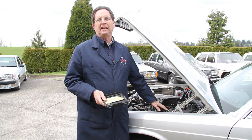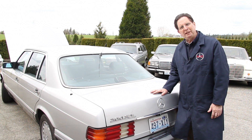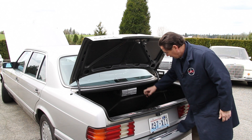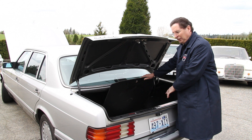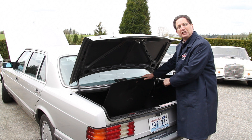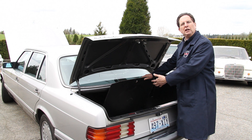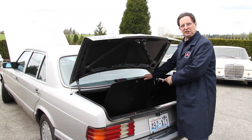Once you've determined the fuse is okay, we need to move on to the auxiliary pump. The 126 vacuum door lock pump is located in the trunk right next to the spare tire. If you lift the cover, you'll see a black rubber housing off to the right side with a number of electrical and possible vacuum lines coming out. It's probably not the best place to put these pumps — as these old 126s leak moisture into the trunk, the pump develops corrosion and fails. That's the primary reason I find more problems with these pumps on the 126 chassis than any other models.